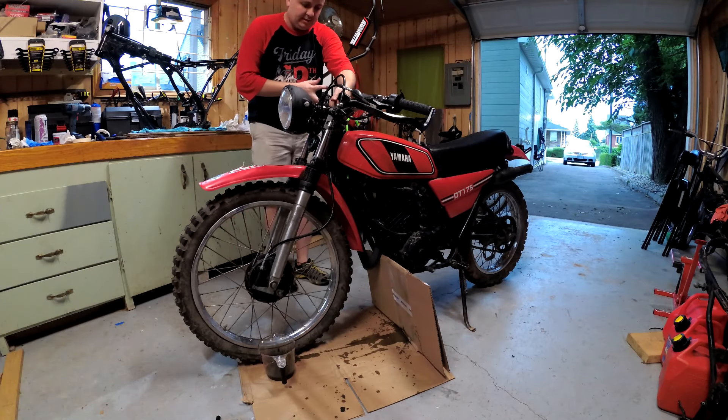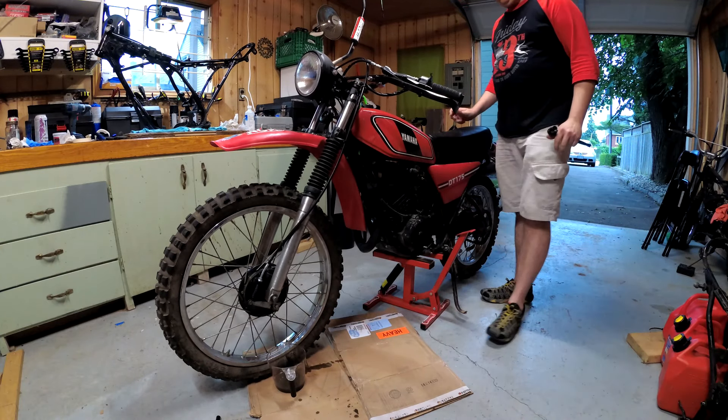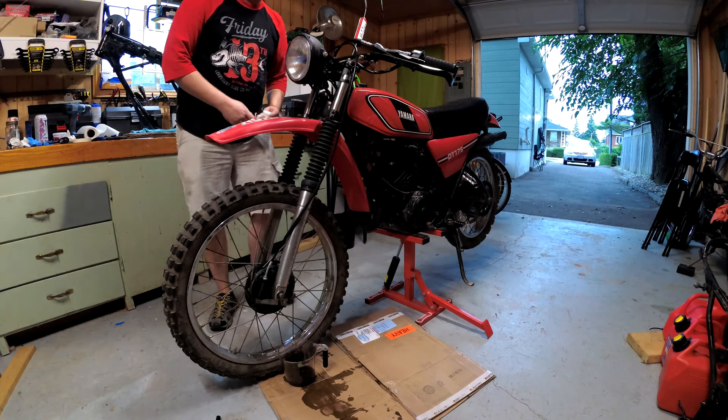All right, let's get her on the stand ASAP. Geez, that sucks. I am so smart. What a shit show. Where did the cap bolt go? Well, this is just dandy. That was stupid. That was quite a fail — I don't know if I'm happy or disappointed that I got that on camera, because now I have to show the world and instead of just being disappointed in myself, I'm also embarrassed. I think the better way to do this would have been to take the wheel off first and then compress each individual fork until all the oil is out, instead of letting all the weight of the bike drop the forks down. The service manual didn't really cover this topic too well, so I just kind of winged it. Probably should have watched more YouTube videos.